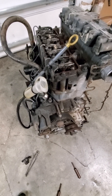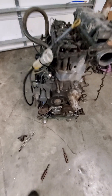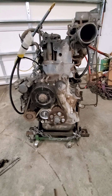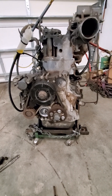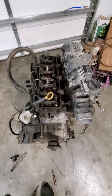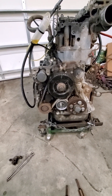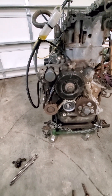Two cranks over and it started perfectly fine. Interesting little engine - once you know what you're doing it makes life a lot easier, but I spent probably a couple of weeks figuring out how to get this thing started. To recap: most important thing is pull the valve cover off, make sure everything looks good. Absolutely must buy a new timing belt with the timing pins and make sure the timing is perfectly on. If it's not exactly right, it'll never start.